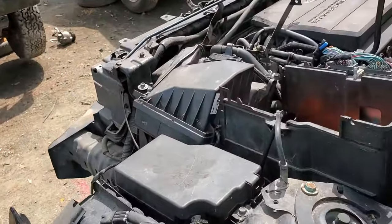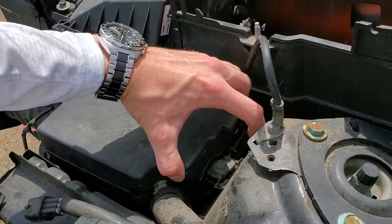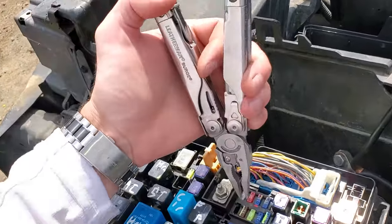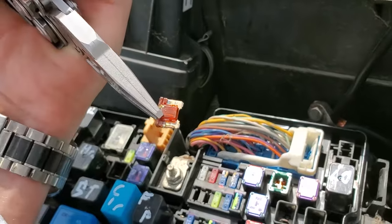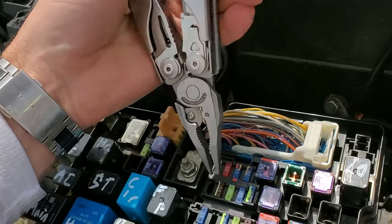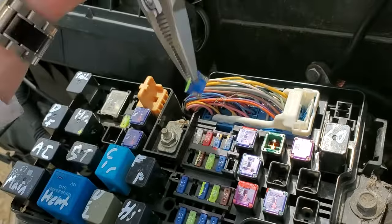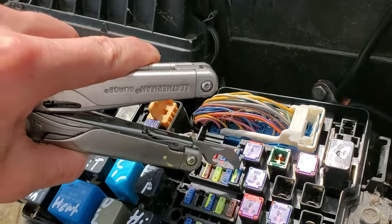Under the hood, this is where the high beam and low beam relay are, as well as some more fuses. We open this box by pushing in on this tab here and lifting up. The BTN2 fuse right here is important — if you've got the self-leveling headlight system it provides power for that, and it also provides power for the relays. There's also a room fuse which is right here — check the room fuse and the rest of the fuses are for the lights.